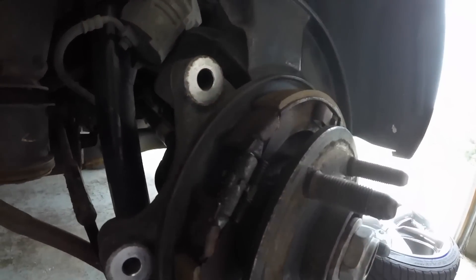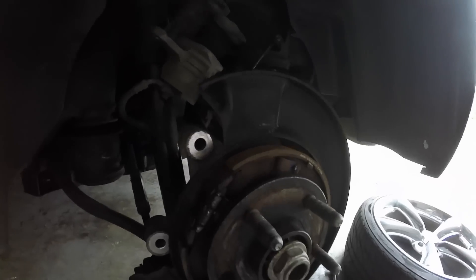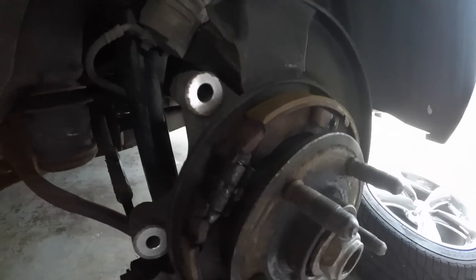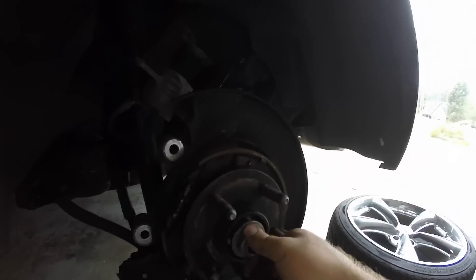I got one of the bolts out on this side, but the others are not going to be easy — not in the best spots to get to. I had to bust out my little portable torch and I heated this one up, and the moment I applied heat I was able to get the tool in there. You'll want to push it back — see how that moves — to get yourself that little extra room to put the socket on the bolt back there. Once I applied the heat I was able to break that one loose. I just have one more to do down here on the bottom, and I'm going to apply some heat to it first.